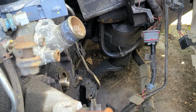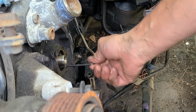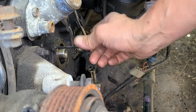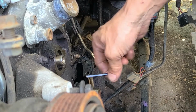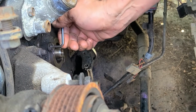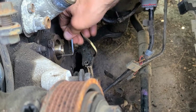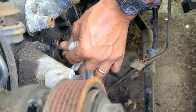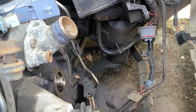So it's in there. They're all going to be different. This is a 5/32, and it's torqued to 8 foot-pounds, which I have no idea what 8 foot-pounds is going to be with this. I think it said 7 to 8 to 10. Anyways, I'm just gonna snug it over, and I might even put a little wrench on here. It's called a cam thrust washer. It feels flat to me. Actually pretty proud of that.